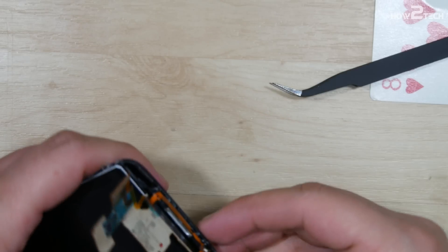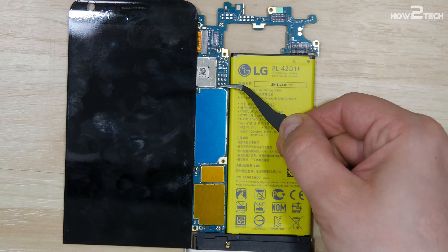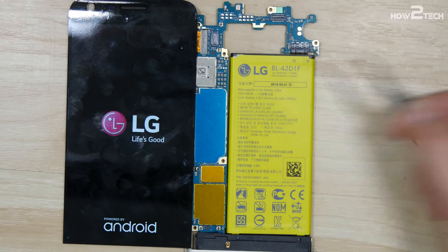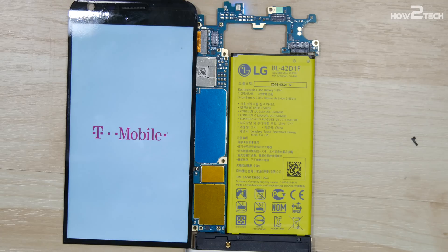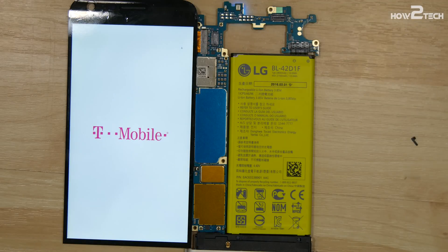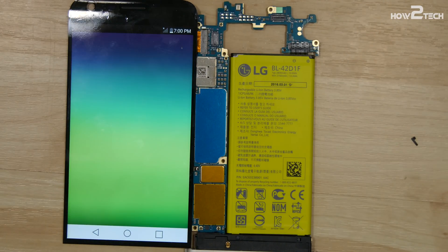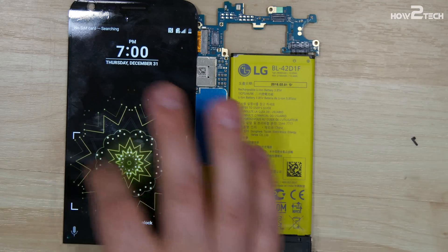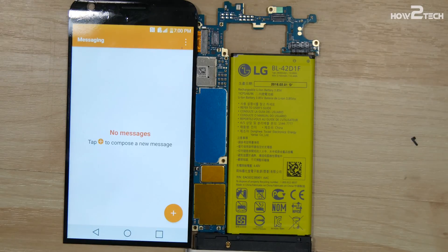There we go — now we have our display. You can see the cable running right above the earpiece speaker. Let's see if we damaged our display at all. The two bottom-left pins turn it on — and we're looking pretty good. I don't see any rainbowing on it, and my little mess-up down at the corner seems to be alright. We've got the T-Mobile logo pulling up, which is a good sign. I'm going to test the touch here in just a second. It looks like I've got a little tiny scrape on the bottom left-hand corner of the display, so just be very careful. But all in all, I think it came out pretty well.